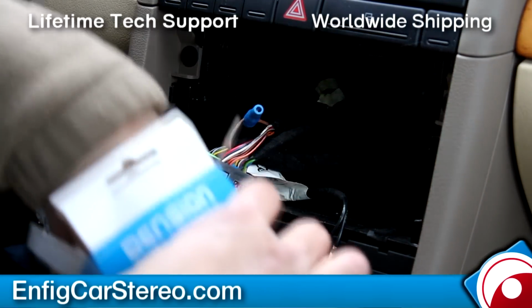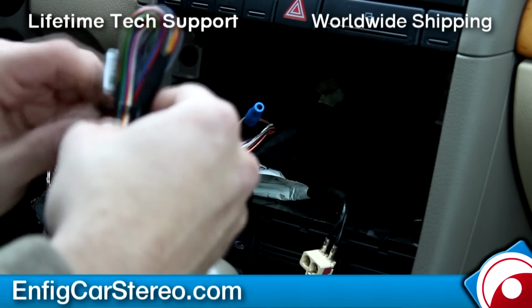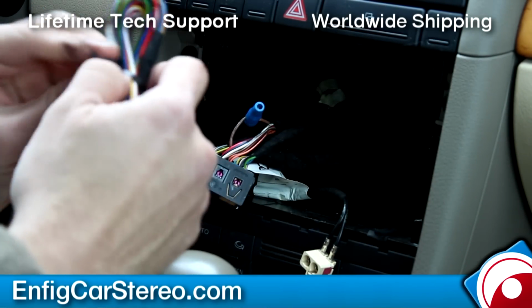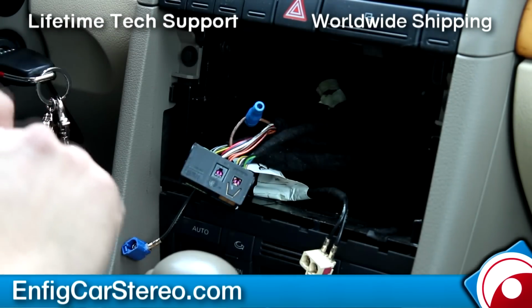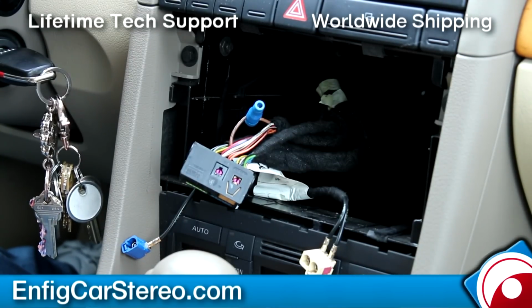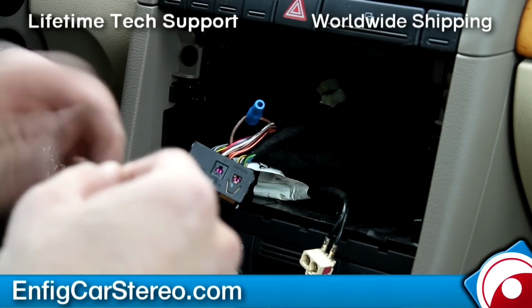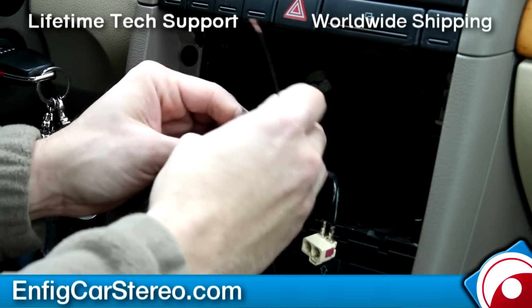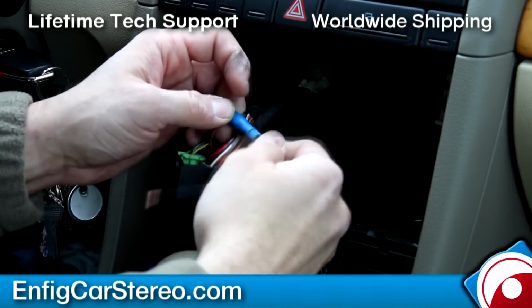This harness is going to have a ground. Now this car has factory Bluetooth, so we're not hooking up the mute wire. This unit has a mute wire because not only does it come with a microphone, it also does phone calls. I guess I'm gonna have to redo this install for cars that don't have Bluetooth. But alright, so we're gonna shave off a little bit like that. Then we're gonna open this side.